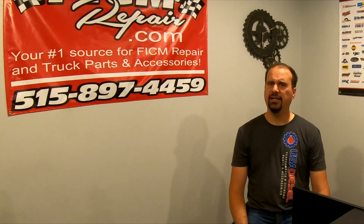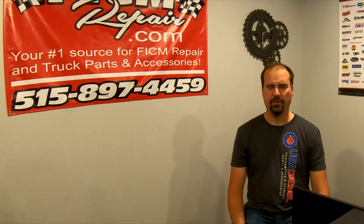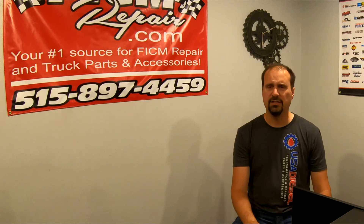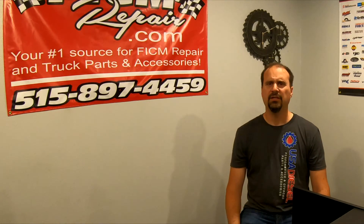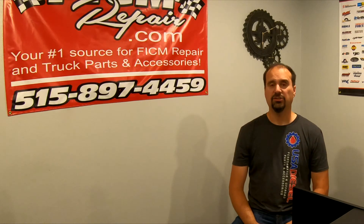The nice thing about the 190 amp alternator is it does not necessitate adding to your cabling at all. But the other options do. The 190 amp alternator does 165 amps at cold idle. The 230 amp alternator does 170 amps at cold idle. The 270 amp alternator does about 220 amps at cold idle. Now, the 165 and 170 amp cold idle numbers sound similar — but the 190 amp unit makes its power in part by using a small diameter pulley, whereas the 230 amp alternator achieves 170 amps at cold idle without any reduction in pulley size whatsoever. Any rotating assembly that spins faster — which is exactly what happens with a smaller pulley — isn't going to last as long.